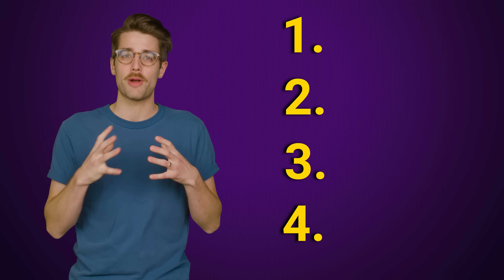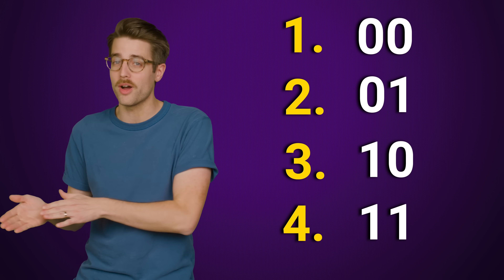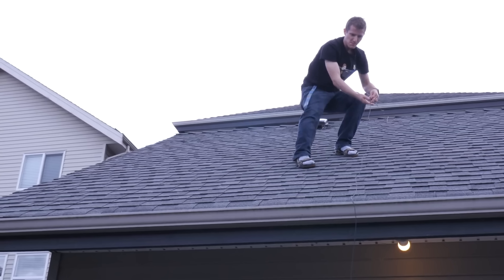No, not the cooking spray. PAM basically means that instead of two possible digital signaling levels to represent a zero or a one, there are four signaling levels that can represent 00, 01, 10, or 11. So you're moving twice as much data at the same time. There will still be dedicated active 80-gigabit-rated cables, which USB-IF confirmed are aimed at folks who need longer cable runs. But to reiterate, you do not need a new cable to get the higher speed over shorter distances.